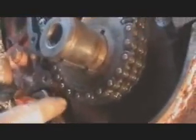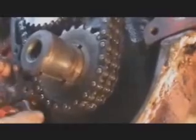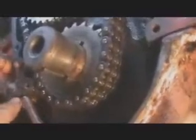And I've gone inside with a light, gone way back inside here, looked, pulled out the old chunk of cork and whatnot, and cleaned it up as best as I could. I'm going to spray some sealer in there. So I've cleaned everything up real good, and I'm getting everything ready to go with the new setup, the two-piece timing cover. So I'll be putting this in like so.